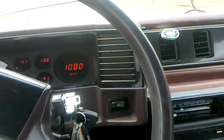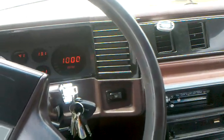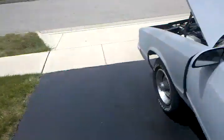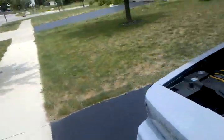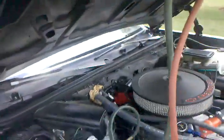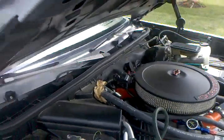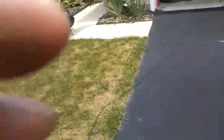If I drive this car it will cool right down and get nice and cold. However, the problem is that at that point I start freezing it up, and as you can see I'm freezing it up — there's a frozen evaporator inlet, and that's not going to work. We're at 40 psi, we should be right in there. The suction line is cold and wet. That's what we've got.